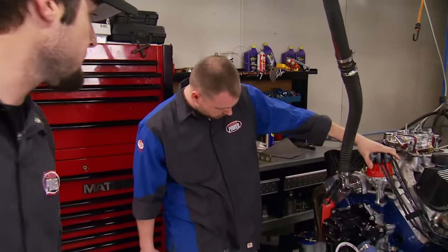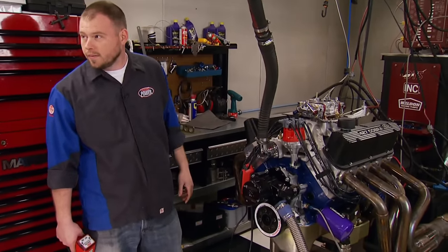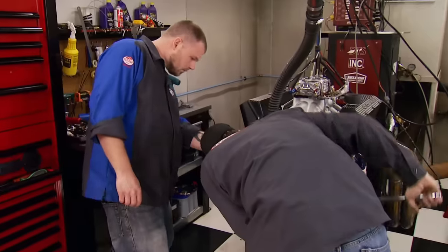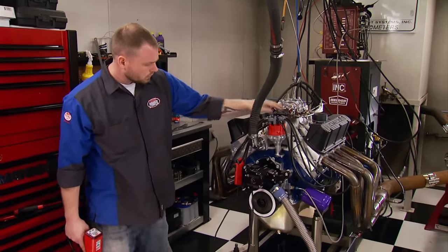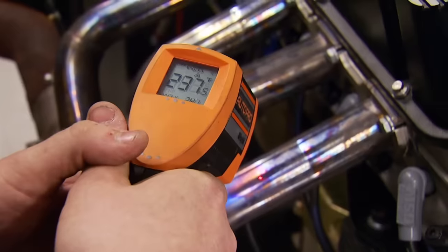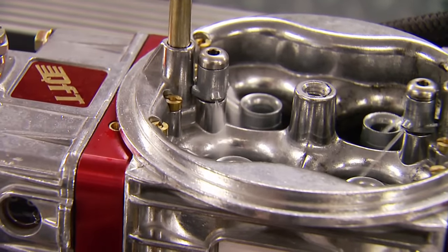The beast resembles a dragon on first fire. We had to check top dead center again as the timing was way out, but after correcting it, the old-style 427 sound is back. No leaks on the first start — things are going to make some power. After break-in, we can see if the power equals the noise. On the first pull we're expecting at least 550 to 555 horsepower.